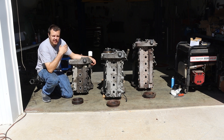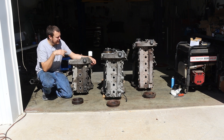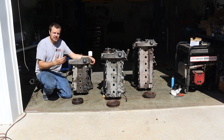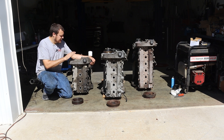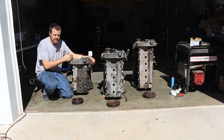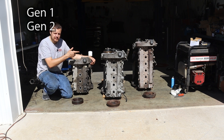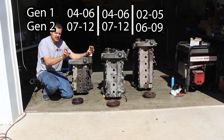Let's talk about the valve covers. All Atlas engines have sort of two generations. The early engines featured a plastic valve cover — what I call Generation 1 engines — and then the later engines converted to an aluminum valve cover, which I call Generation 2 engines. This is a very good way to identify what you're looking at, because with the later aluminum valve cover engines, they made quite a few changes, such as bigger intake cams, bigger valves, and with the 4 and 5-cylinder, they went to a larger displacement. The 4 and 5 went to Gen 2 in 2007, and the 6-cylinder went Gen 2 a year earlier in 2006.